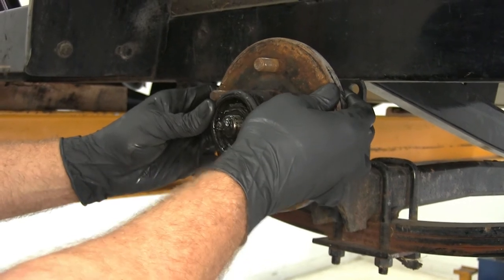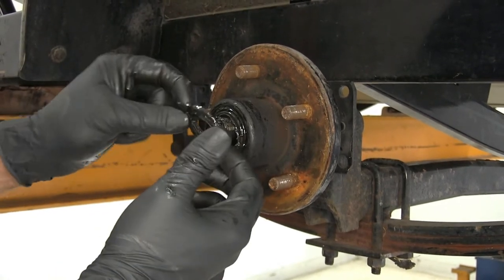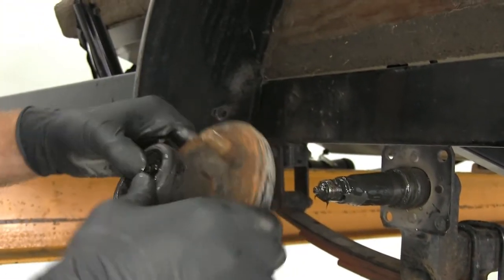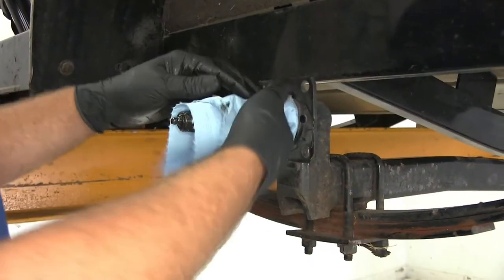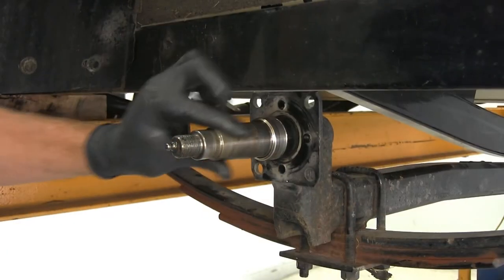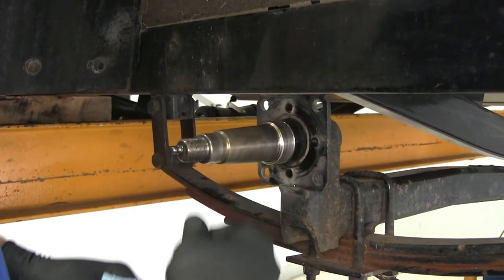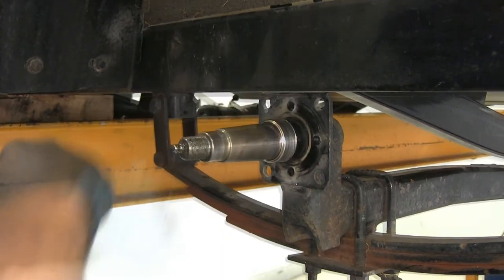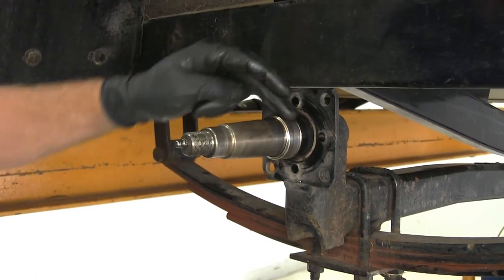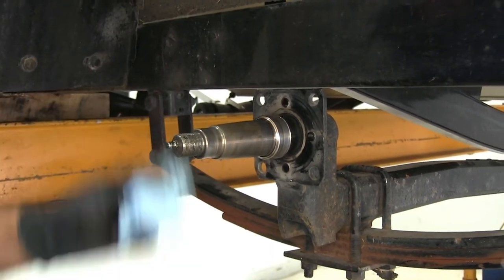Pull out just a little bit on the hub and you'll see the bearing in behind it, and in front of that there's a little washer — hang on to that as well. Then take the inner and outer bearing, hub, and seal off and set aside. Clean all the old grease off the spindle. Look on the flat surfaces for any kind of damage, dents, or anything that shows bearing failure in the past. This one's nice and smooth on both surfaces, so it's in good shape.